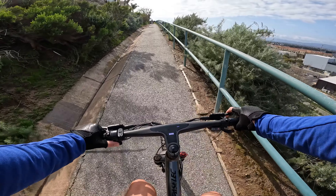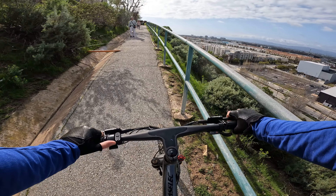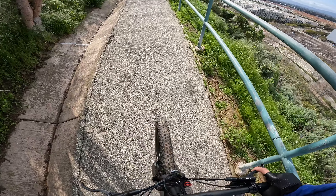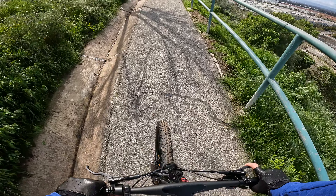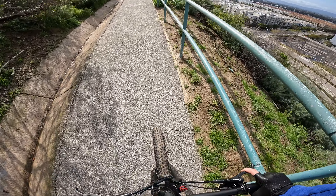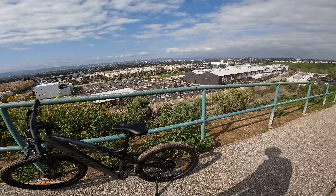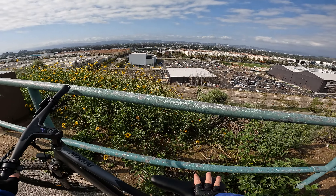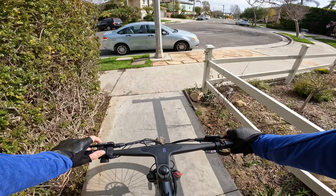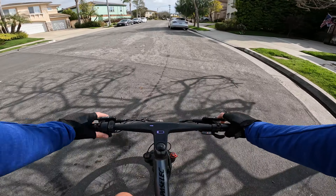The controller is probably overheating or the battery is giving out — it just keeps turning off. The controller is getting way too hot. I'm just going to pedal up the rest of this with no assistance. Riding an e-bike when you don't have battery or assistance is not fun, especially uphill. The motor cut out on me a couple times going up this hill, which was pretty challenging. If you're planning on doing a ton of hill climbing, this probably isn't going to be the one for you. What happens on these bikes is they'll cut you off so you don't damage the bike — you don't want to overheat the controller.